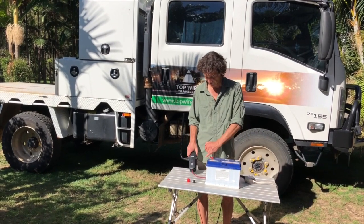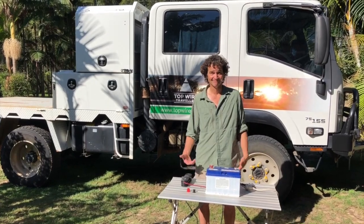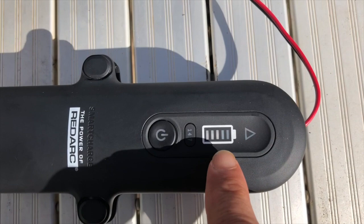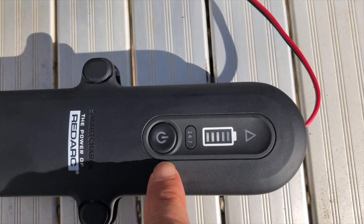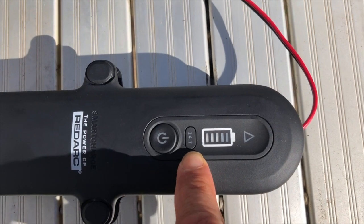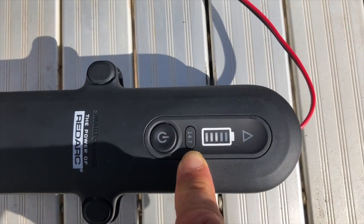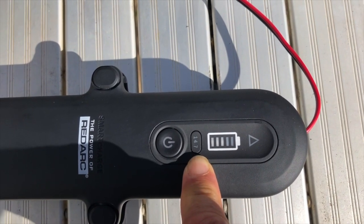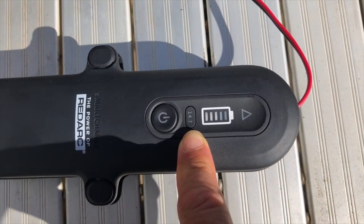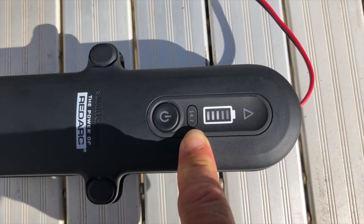When the symbols on the battery charger stop flashing, it's done. Here are the details of the top of the unit. That's the on/off button. That one there says 14.7 — some batteries require a higher charging profile. So you press that button if that's the case, and that's clearly stated on the battery if that's the case.